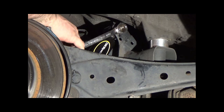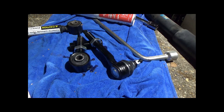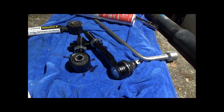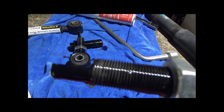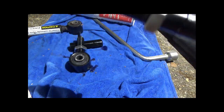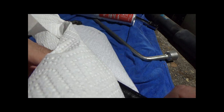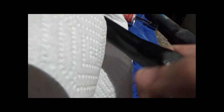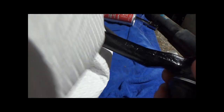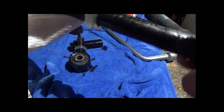I plan to re-inspect these after one year — I'll disassemble them here on the channel to see if this trick prevented any rust. Even if it doesn't work, I'm happy to spend $60 a year on rear toe arms to prevent my tires from wearing out 20,000 miles early. My rear tires had significantly less tread on the inner side. I do believe this will solve the problem, and I don't anticipate any issues besides maybe repacking the toe arm with grease once a year after inspection.